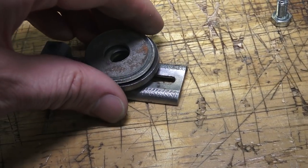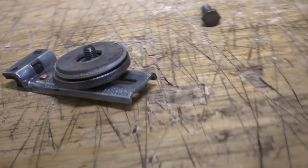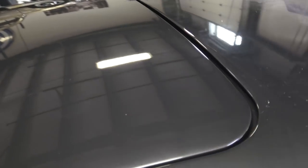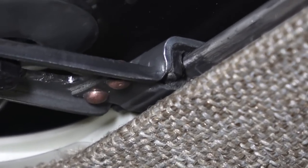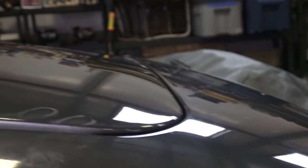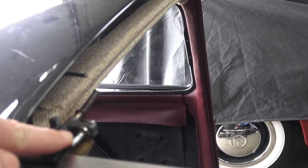We stacked the washers and got a 6mm bolt with a 10mm head — depending on how many washers you use, the bolt length will vary. That piece makes the center square panel flush with the roof. Right now the center square piece is down — not even with the roof of the bug. You slide the slider onto the rail, add your washers and bolt, hook it up to the threads in the roof, and that gives you the flush look. That's what that piece does.